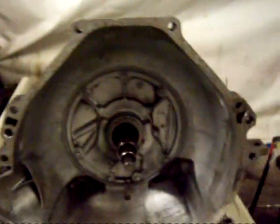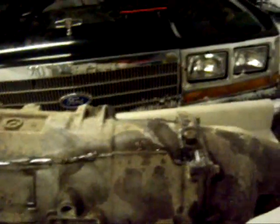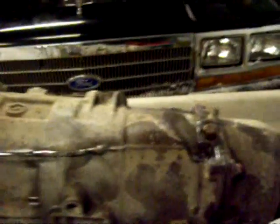I'm going to go ahead and start taking it apart. First thing I'm going to take off is the neutral safety switch, which I've already loosened with my wrench. Then I'm going to take off these six extension housing bolts and take that off and out of the way. I'm thinking this transmission has been opened up before — it looks like it's been painted silver, and it's got a blue torque converter, which I've never seen in a factory Ford transmission. It doesn't have third gear — that's what was wrong with it — so I'm thinking the direct clutch has gone bad and it's all burnt up. We'll figure it out when we get in there.